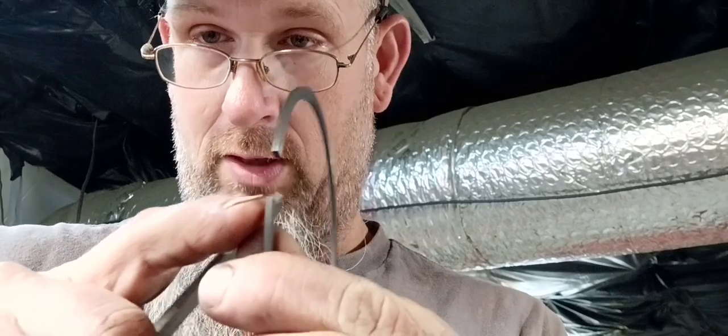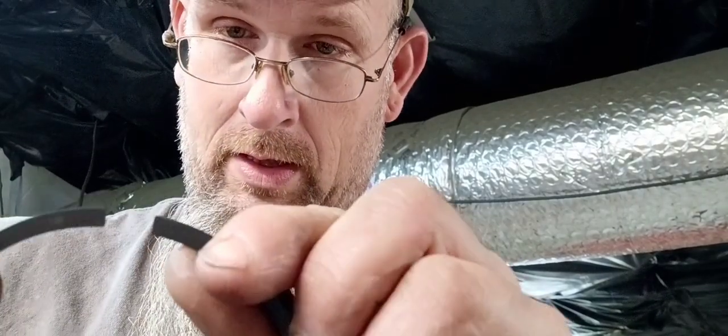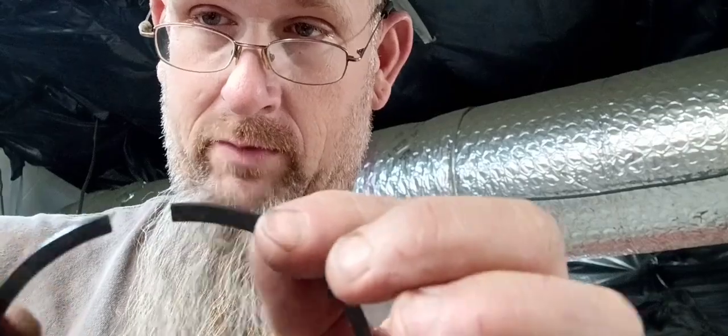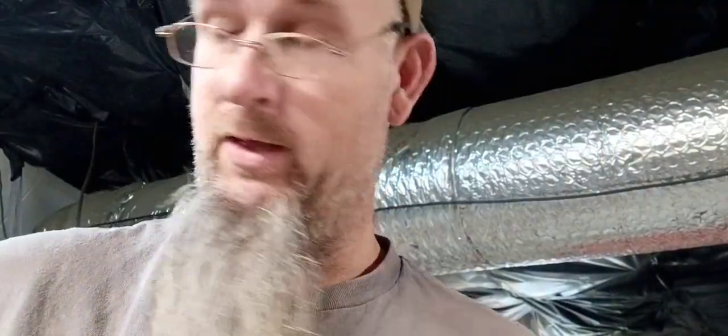both sides. I'll touch them, because a lot of times what you run into with these rings, and I'll show you here in just a second, is they're not totally flat on these ends. Even though they should be, they're totally not. So what you're trying to do, most times, is take the defects off of them. So I've already done that on cylinder 1 and 2. So I'm on cylinder 3 now on this second ring. I'm going to go back and just touch the top ones, just to make sure they're flat on the ends. And I'll flip it around and I'll show you kind of midway through the process.